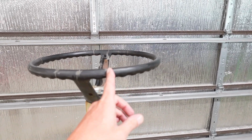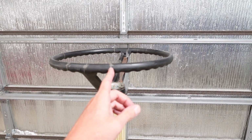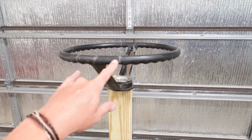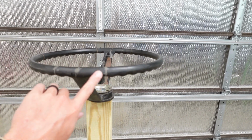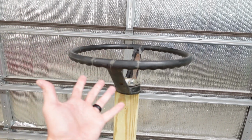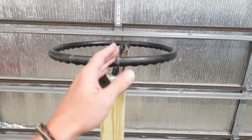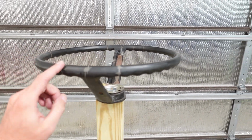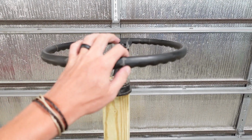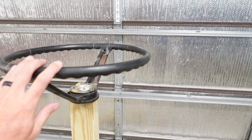So what we do, first and foremost, is we get into them cracks with some alcohol, some sort of a cleaner, because you gotta think about this for a minute. Paint does not like oil and grease. And the filler product's not gonna like it either. This thing's probably been drove for how many years? This one's from 1968. It's been drove for how many years? Probably with cracks in the steering wheel. So all your hand grime and oils and grease gets down in there. So you wanna get in there with a Q-tip, some cotton, some kind of rag, and some alcohol. Clean those areas out all the way down to that metal wire. That way, all of our bonding agent has a good surface to stick to.